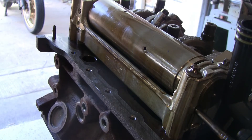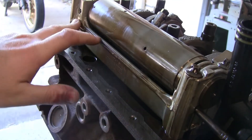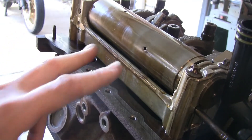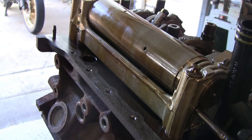For those with these motors trying to do a timing job, this should shed some light on what was quite a frustration trying to figure out how to put it back together. I've been reading on the Ranger forums — apparently you can delete the balance shaft, but you have to put a blocker plate in because oil flows through at least one end of the shaft to lubricate the bearings. I just didn't want to mess with that. I wanted it to be correct and have the balance shaft in it for a smooth-running motor.